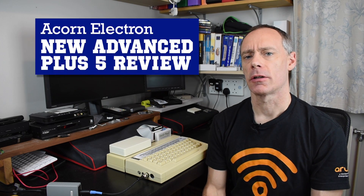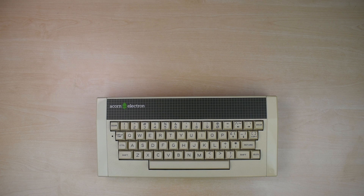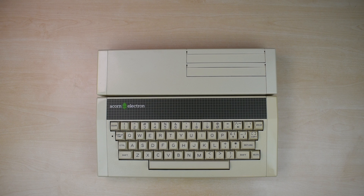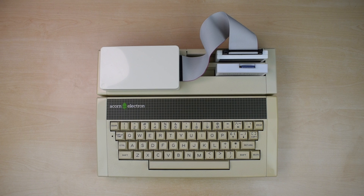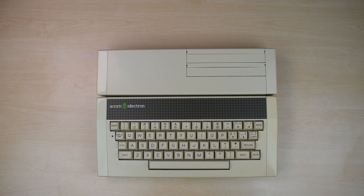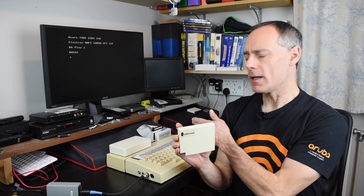Hello again. If you've been watching my channel, you'll know that over the last few years I've been gradually pimping my Acorn Electron. First I added an Elk SD64 to give me an SD card interface and avoid needing to use tapes, then I replaced it with an Acorn Plus One expansion box, and added Elk SD Plus One and Advanced Tube Interface cartridges for extra sideways RAM and second processor support, and finally I added an AP6 version 2 inside the Plus One to add some extra sideways ROM and RAM banks. But about a year ago I bought one of Roland Lehr's Elk Econet cartridges for the Plus One, which is great, but unfortunately I've got no slots free, so to use it I'm either going to have to lose the SD card interface or the tube interface.